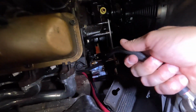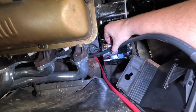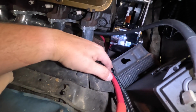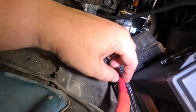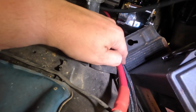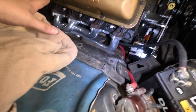Like I said, this negative cable is going to end up routing something like this, I think, so that I can maybe take a zip tie or something and put this over here on this alternator, just to double check and make sure that this doesn't get against this exhaust. The way the positive is run, it's run down below the motor mount, so no chance of getting into the exhaust at all. I might still run some of our big sheathing on these. I always like to run some of that sheathing just to be precautious. I know this is good and insulated, but just a little bit extra in case it rubs, so it doesn't chafe or do anything crazy. So I might still do that, but that is all there. That's how that's going to end up living, I think.